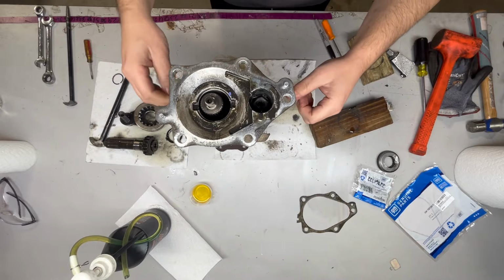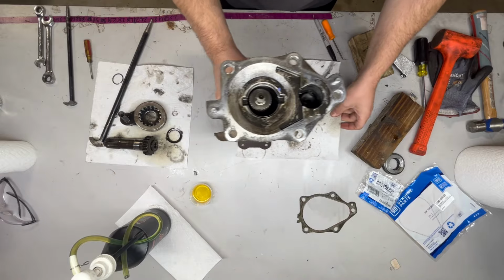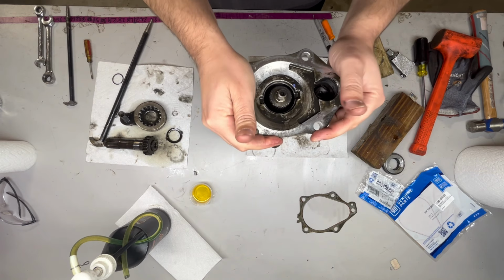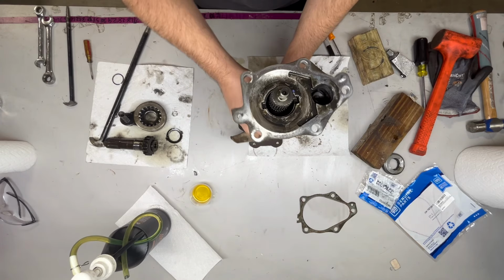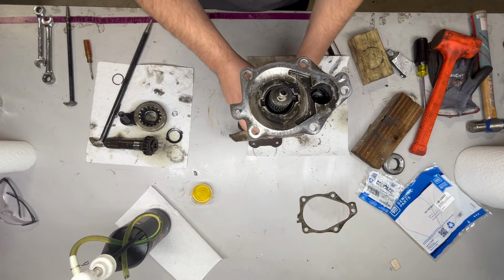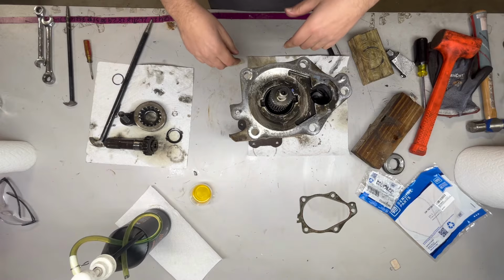All right, so now when you get to that machine surface at the end of this axle, you're going to get some resistance as you're pushing it on. And you just want to have it nice and square as you're seating that seal. There we go. So it seals on. It'll pull back as we tighten it up or install it. So now we're going to reverse the process.